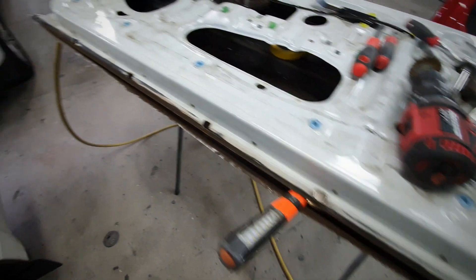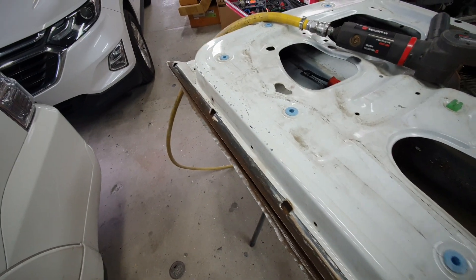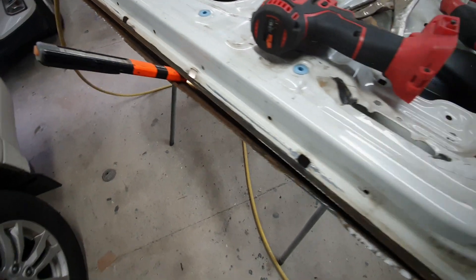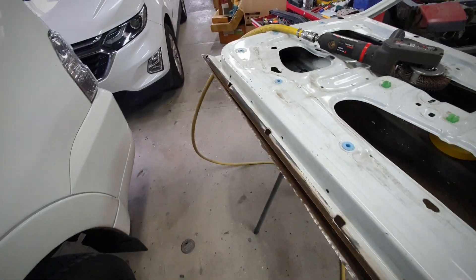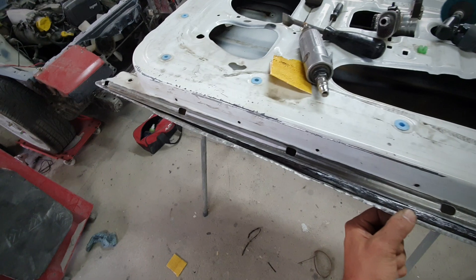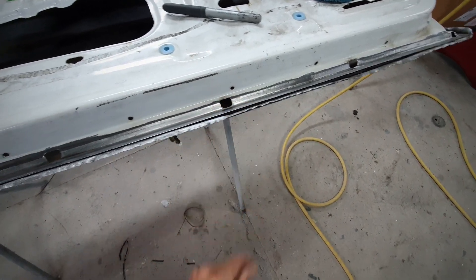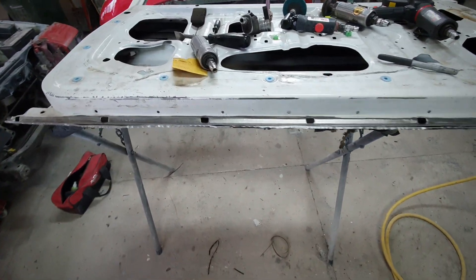This door isn't as bad as the other door. Just been giving it a bit of a scrape out and a quick buzz over with a smaller wheel because these are quite thick and hefty. Going to carry on cleaning through here — this end is a whole lot better and cleaner than that end. The second door is all clean along the bottom now. Cleaned it out the best I could. Tried to clean out the best I could between the seams — as you can see it's all metal through there. I'm going to spray my rust neutralizer in between, let that go off a bit, and then do another coat and fold the flange around while it's still wet so it doesn't crack.